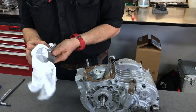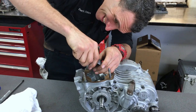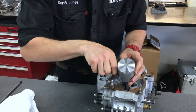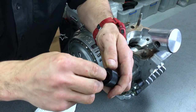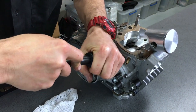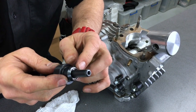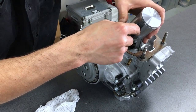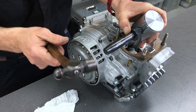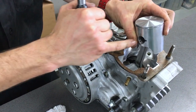Then we can reinstall our piston with our piston pin pusher. Next up we're going to insert our piston pin circlip — we've got this little tool here from Rotax. We insert the piston pin circlip like so; it's got a little groove there to stop the circlip from flying out the end. Then we just insert that into the piston, hold it very carefully, and give it a light strike with a hammer. That fires the circlip into the circlip groove in the piston, which is what stops the piston pin from falling out.